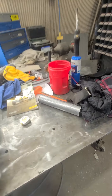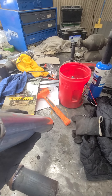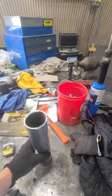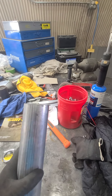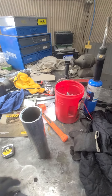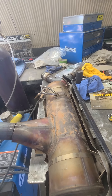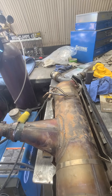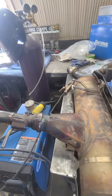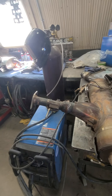We bought a two and a half inch straight pipe. In my case I used one from Amazon, which had slightly thinner metal, so welding is harder because it's easy to burn through. This one we got from NAPA - it's a much thicker pipe, so it's easier to weld. Once we weld the pipe in place of this piece, we'll push the muffler back in and re-weld it. That's it and that's what you need to know. If you have any questions let me know - we'll try to shoot some pictures of how we do it. Take care.